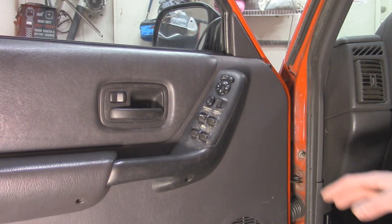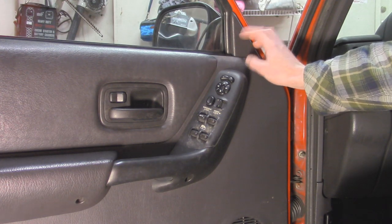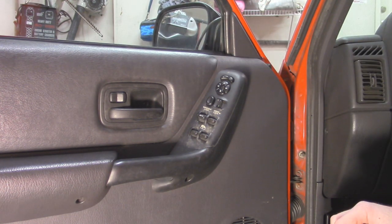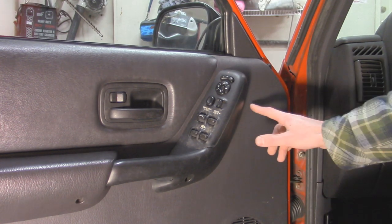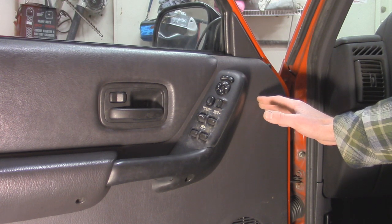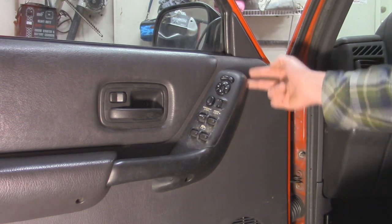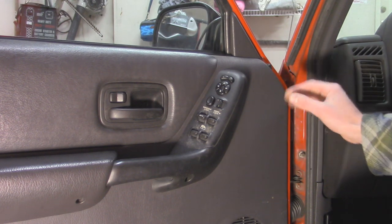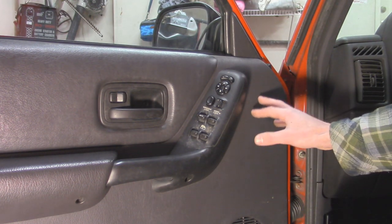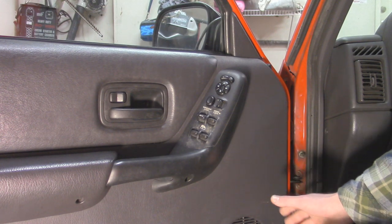Looking at the front door panels here — if your Jeep is equipped with the Infinity sound system, there's going to be a little triangle piece right here with a tweeter molded inside. They're pretty rare and people want a lot of money for them; you can sometimes see them on eBay. As an alternative, we're just going to put one in the door panel. I've done this on my other Jeep and I found that the best spot is right over here in this area, because right behind this plastic panel you've got the shell of the door which has an indent right here. So you can put it at whatever height you want and have enough clearance for the back of the tweeter not to contact anything.